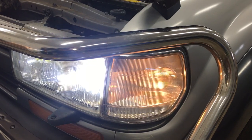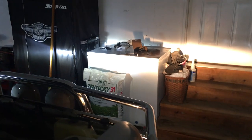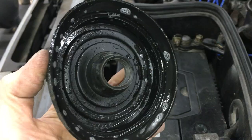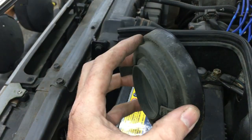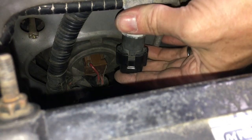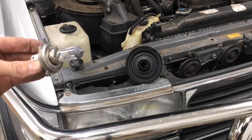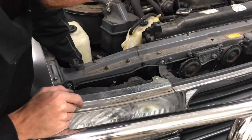I might get an amber bulb for the corner light now instead of this off-white bulb — I think it would look better with a little more contrast. Look at how much faster the LED bulb switches from low to high beam compared to the halogen bulb. I sprayed some soapy water around the outside edge of the cover to help it slide back on easier. Don't use any kind of oil-based spray because that can degrade the rubber over time. Plug in the bulb, and done. The other side was the same process, except I had a lot more room to work after I moved the coolant tank out of the way.